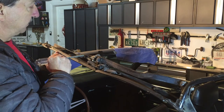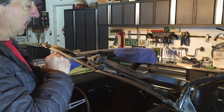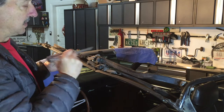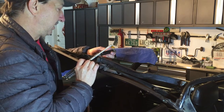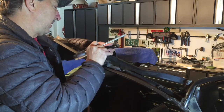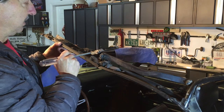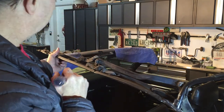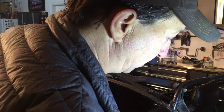So it is a good thing I'm taking this all apart. I do need to carefully bend that back where it belongs, because this is riveted on. My Buick Skylark was all bolted together, so I was able to just take those bolts apart and put in new bushings. Hopefully these bushings are good — they feel really solid, there's a little bit of movement in it, nothing to be concerned with. I'm just going to have to carefully bend that to the correct shape. Nothing else here seems to be standing out as any issue, but I'll go through and check all these areas.